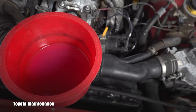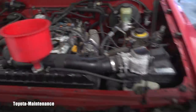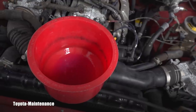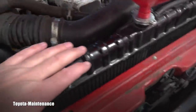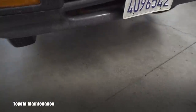I'm not touching anything — you can see the air bubbles coming out, boom, another one. This needs to be done for a long time. If you're working in the garage, make sure you have fresh air coming in — you don't want to poison yourself with exhaust fumes. Look, the level is coming down. If it needs more, I have to add more coolant. I recommend keeping everything tidy, clean, and dry during this kind of diagnosis work.